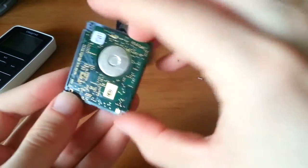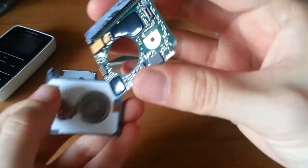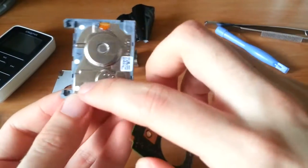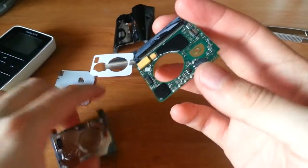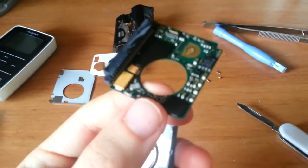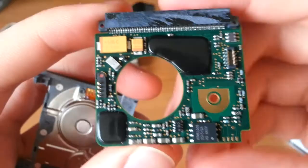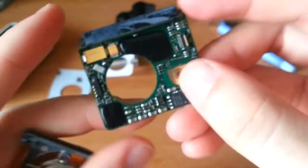Okay, anyway. Please don't tell me there's anything more. So this should just pop out. Yep. And there's a little spacer and a tiny little molex in there which connects to the armature. And these four little press fit contacts. Oops. Oh, well, thank God it's already broken. That connect. Here, let me get a focus on all this. There we go. That connect to this little guy here, which these are press fit connectors.